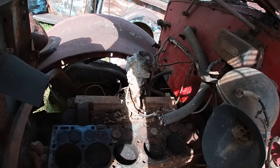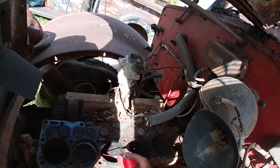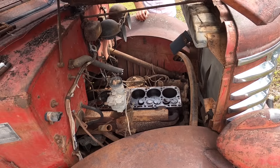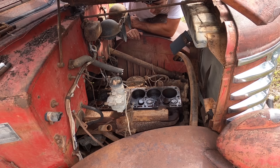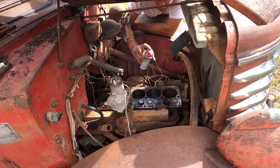Probably spray some WD-40 down in the cylinders, then shop vac it out — that's what I'll do right now. Let's get it around these rings. After sitting for 66 years, this motor's in better shape than the Starliner that only sat for 54 years, but they sat in different areas. I shop vacced out all the cylinders off camera because that shop vac is louder than a Cummins diesel running. The cylinders don't look terrible. I sprayed more WD-40 in there — it's starting to take off that corrosion on top of the pistons, and there's also a little corrosion around the valves. I sprayed all the valves that were open and closed around them to hopefully help lubricate things so we can get this engine turning over.